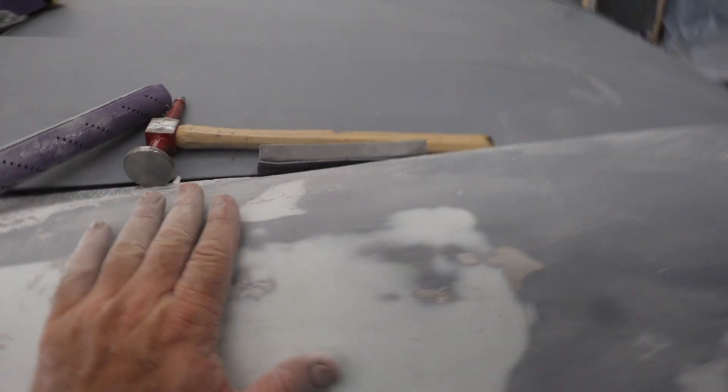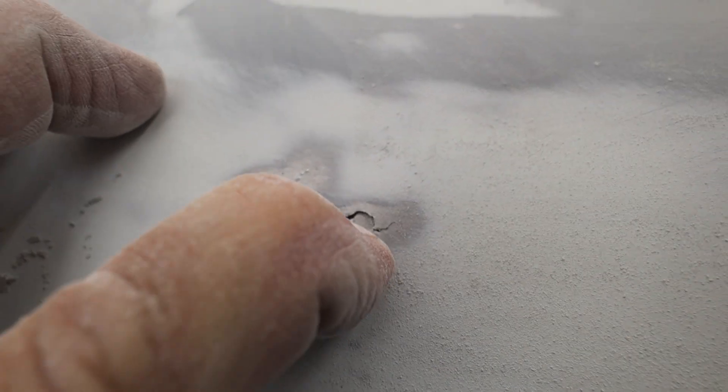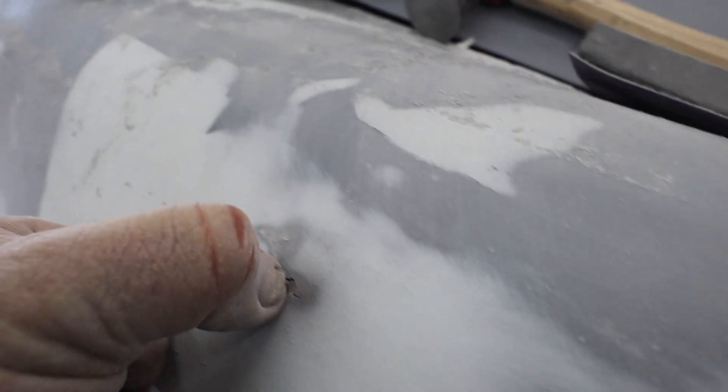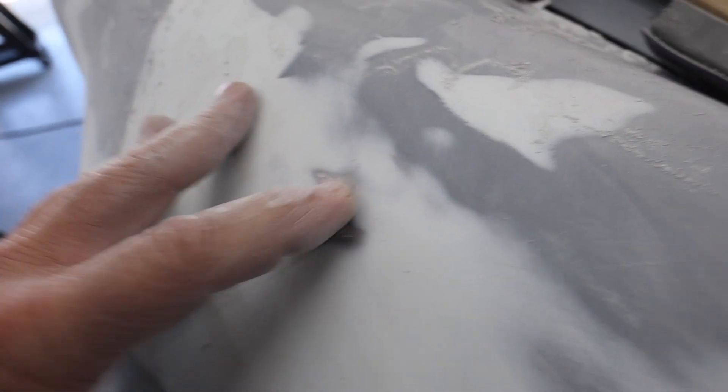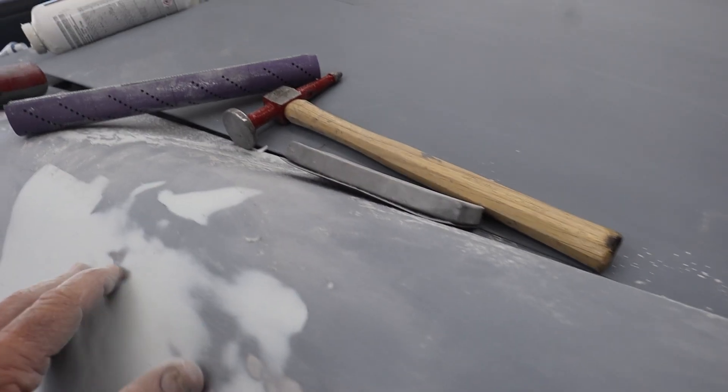My fender flares are coming back to bite me. This area here is so thin it has cracked — I can feel how paper thin it is. I'm going to have to grind this whole thing out and address this situation again. I thought I had it fixed but it's still too thin. If I weld it and it blows through, I might actually try to use lead filler on it — try to lead fill this section. I'm having a really hard time getting this thing to cooperate, unfortunately. This is going to be a pain in the butt.